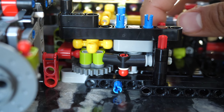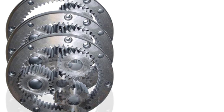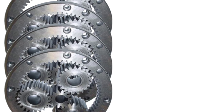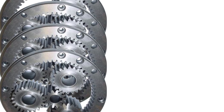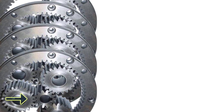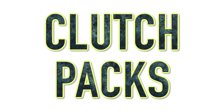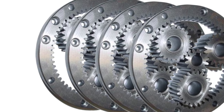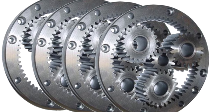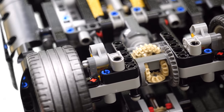Some of the most common types of automatic transmissions are the ones with paddle shifters. These types use a combination of planetary gear sets — you have a bunch of these gear sets all connected in one line. You change speeds by transmitting different speeds into the sun gear and the ring gear, and you use clutch packs to block or release the gears. Such a transmission would be revolutionary in Lego Technic, but if too difficult, Lego Technic can always use an automatic transmission with differentials.